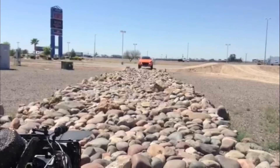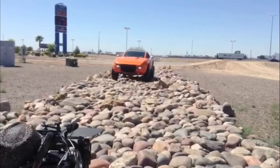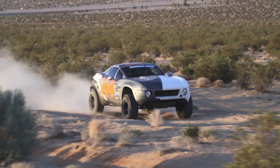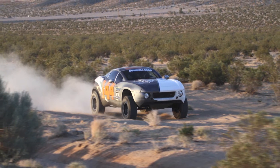In cases where you're in a rocky section in a four wheel drive, you'd be going really slow and crawling over. The Rally Fighter has enough wheel travel that it'll just glide right over whatever obstacle might be in its way. The Rally Fighter is also available with different forms of traction aids — be it a spool, a limited slip, or a Detroit locker. The Ford 9-inch rear end is very customizable, so you can have whatever traction aid you want in there and you can really go just about anywhere you can in a four wheel drive.